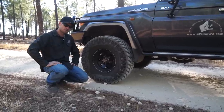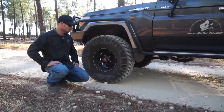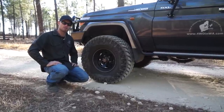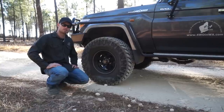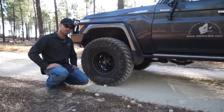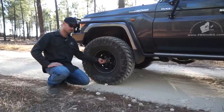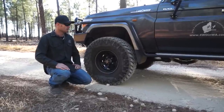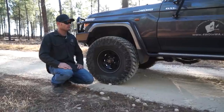If you don't do a lot of four-wheel driving, it's actually good to keep your hubs locked every now and then, just to turn everything around in your diffs. So there you go — you can drive with your hubs locked on a manual locking hub vehicle.